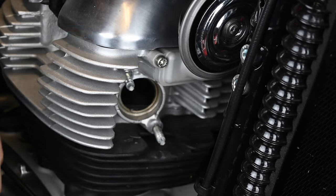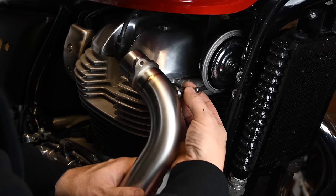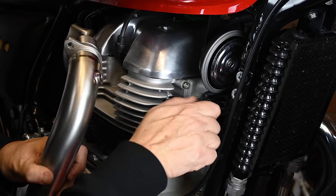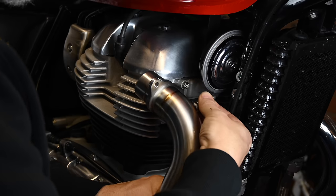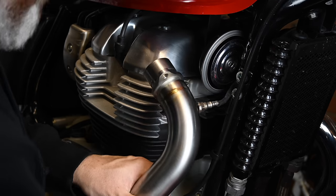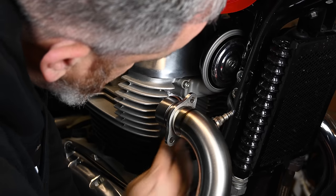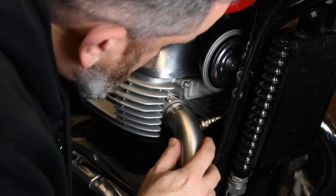Fish out the O2 sensor — that's going to go back in. What you have to do is remember to put a little bit of twist onto it so that when you put it in, you've got a little bit of slack. There we go, that's the O2 sensor in. Pop the crush washer in there and line up the bracket.